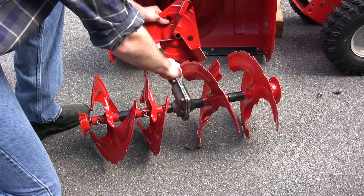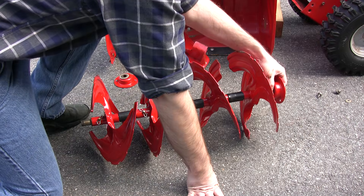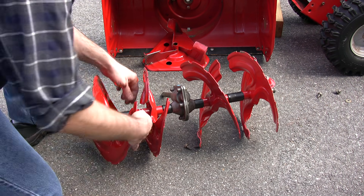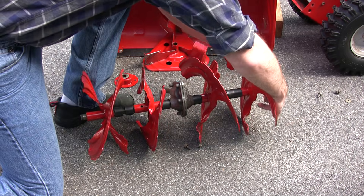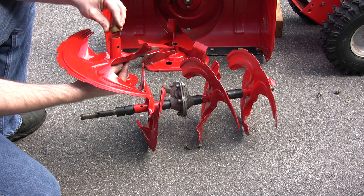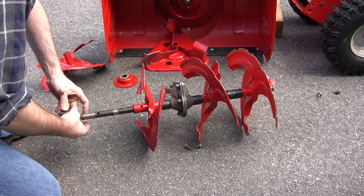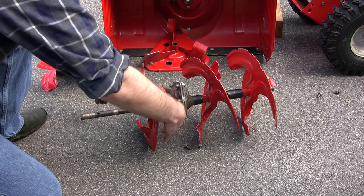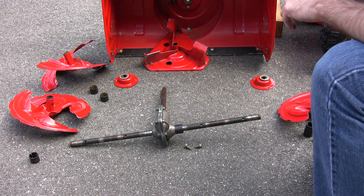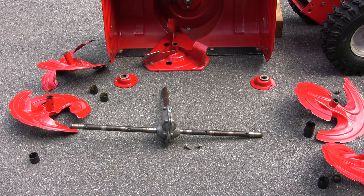Now with the whole unit off, remove the impeller and then take off the washer and holder from each end and start disassembling. When you take these off, be careful you don't lose all the little inserts that are in each side of these. And there are spacers — it goes two, then one. And there you go, we're ready to open it up.